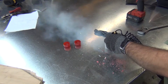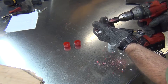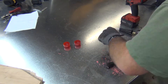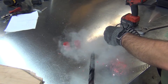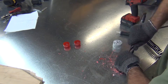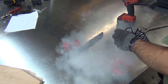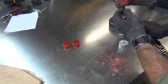Using the kit's injector — I don't know what to call it — it's the part that goes into the clamp and fills the clamp with liquid CO2. Anyway, using that thing, I froze the tie rod end boots by spraying them with liquid CO2, utilizing the failed mold as a holder. See? I recycle. I sprayed the boot until it looked cold enough — a thermometer would probably have been helpful here. I quickly grabbed the boot and used a vee bit to drill out the top hole. I used a vee bit because it effectively removed material but never grabbed the boot out of my hand. I repeated this process until the hole was big enough to ream it out with a 1-inch drill bit.